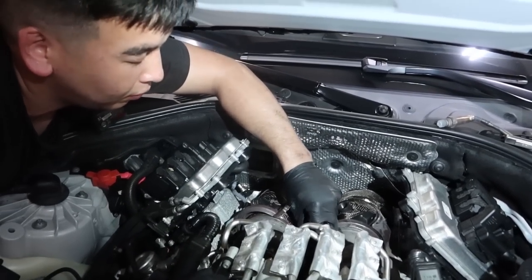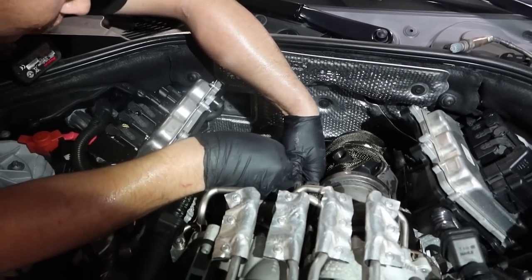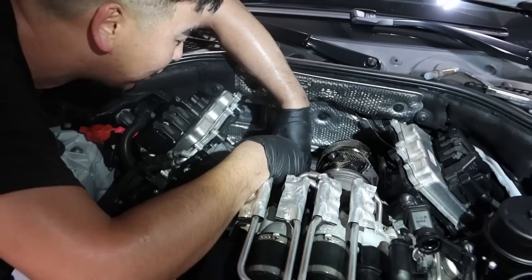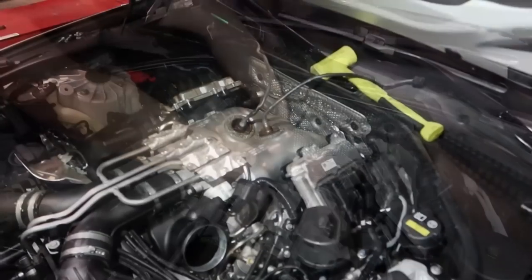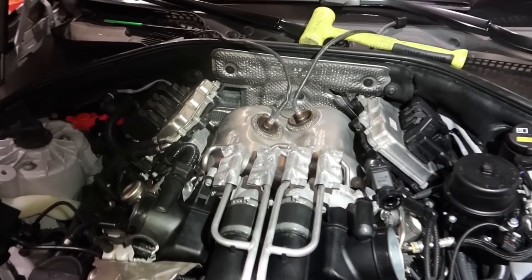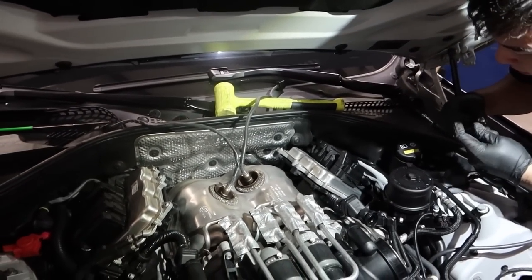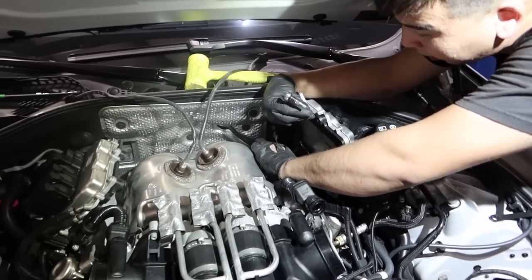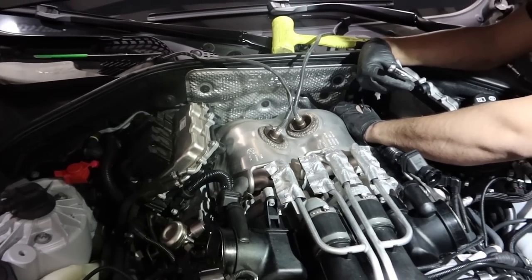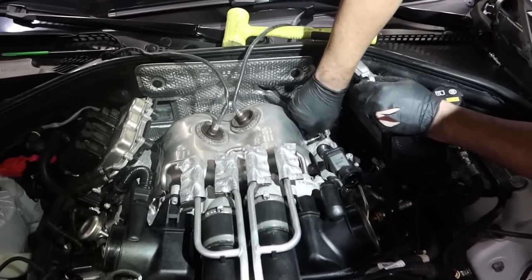And also the top heat shield, if you don't put it the right way because it channels in, it won't seal all the way. But the most important thing is that these two surfaces mate together the right way. Dang, the fit of this is pretty nice. Everything lined up perfectly. This is why I bought what the IND guys said to buy, because just like you guys, they're testing a lot of stuff, unlike most. The fitment is definitely pretty good. All the brackets went in right, those two sensors went in properly, and it looks good. We just tighten everything down the same way it came out.